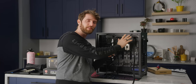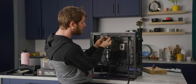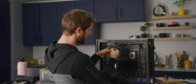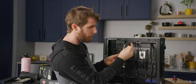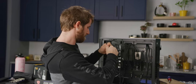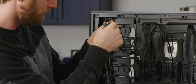Once you've got all 12 fan screws in, and hopefully you oriented your fans so that the cables come out toward the back of the case, you can go ahead and plug them into those cables that we routed away from the CPU block before. Conveniently, MSI provides nice little labels on these. Included with the CPU cooler is a one-to-three addressable RGB splitter, so we're gonna use that to go off the male connector off the block and plug into all three of the female connectors for our fans.